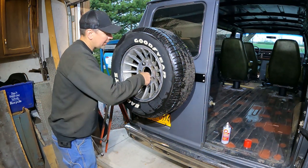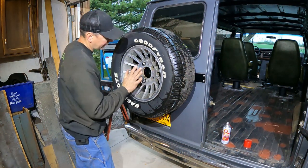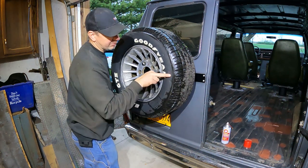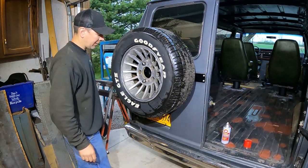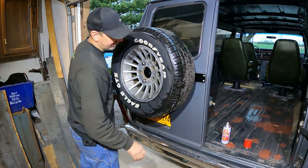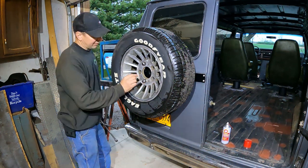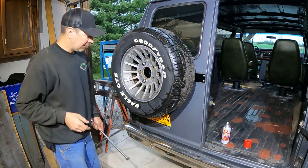Now I'm gonna use an open face lug nut. I'm gonna thread it on the back side of these studs so I can bolt the wheel to itself, and I'll shim it. Right now the tube of the tire carrier is pushing into the sidewall of the tire, and I don't want to put a divot in the sidewall and have it be that way forever. So I'm gonna take this back off, spacer it out, and then I can get a positive lug nut, and I can crank these right down because it'll be steel on aluminum. Let me do that.